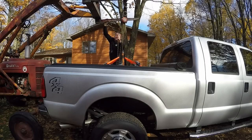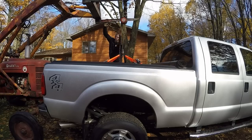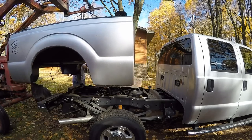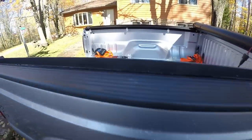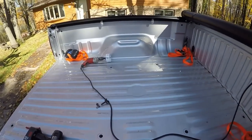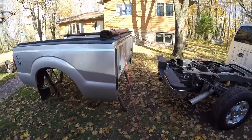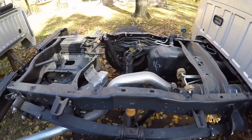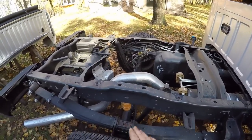These pickup boxes really aren't that heavy, so this light-duty chain hoist with ratchet straps going to all four tie-downs is going to be plenty to get it lifted off the frame. Now that the box is off the frame, I'm going to drill the five holes through the bottom of the bed required for the hitch. You really only have to block the box up on the chassis to get enough room, but I prefer to take it right off so I know I won't hit any components between the frame rails and I'll have a lot more room to place the hitch components.